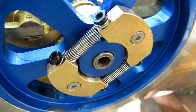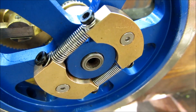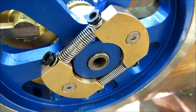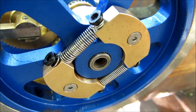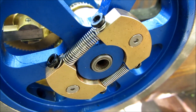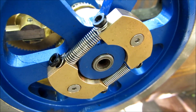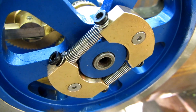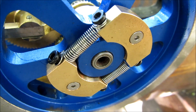This slowed the engine down and definitely helped it. I may try two additional springs using 0.10 diameter music wire just to see which I like better.